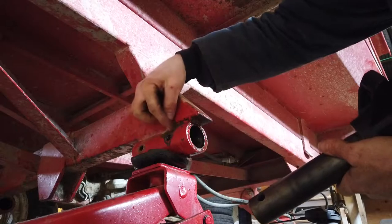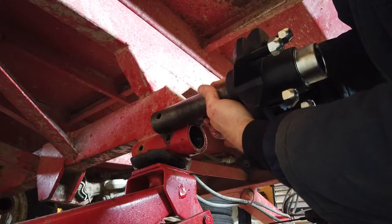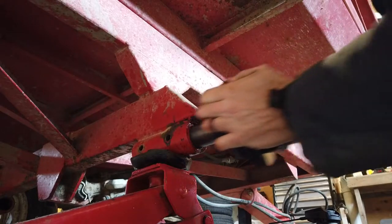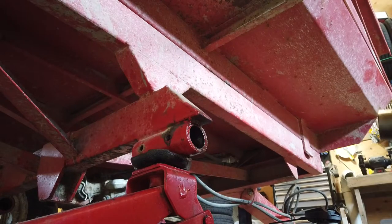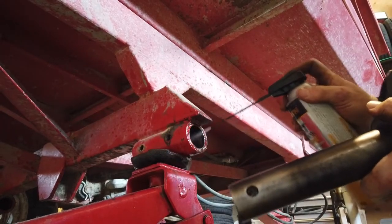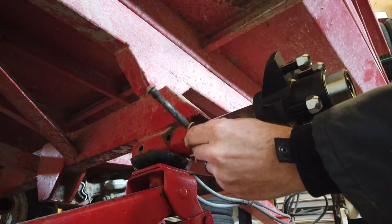So you can see the two holes. They're going to engage that hole in the spindle. So this trailer, I guess, was designed to be set up with the spindle in that far or in that far. I'm probably going to put it back the way I had it for now, but I do plan on experimenting with that this summer just to see. Why not, right? I mean, no doubt it would be stronger if that spindle was all the way in, but your trailer is more stable with a wider space between the wheels. I'm gonna go clean up this bolt on the wire wheel.